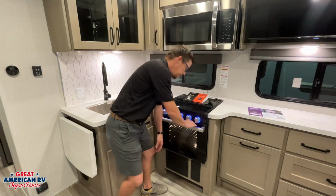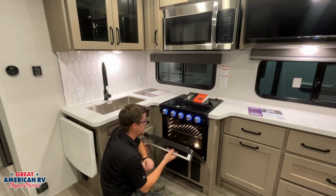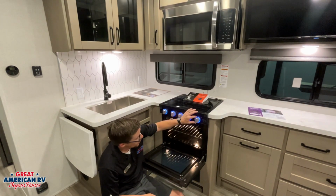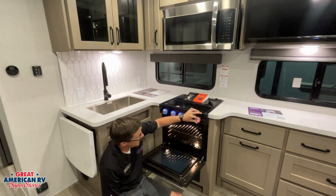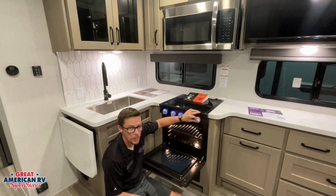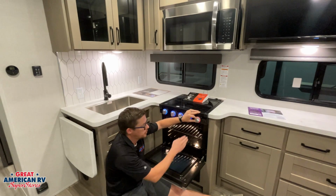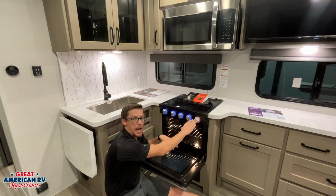It's a good notation that the gas system is on, so we can turn it off. Our oven down here at the bottom is going to work in somewhat of a similar manner. We're going to turn this knob right here to the flame icon, but we have to hold it down. If we're not holding it down, the gas isn't going to emit out of the orifice right there. Then we come over here and manually crank it until that pilot lights.